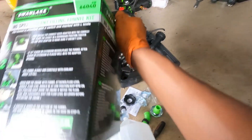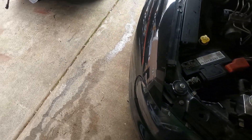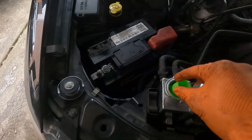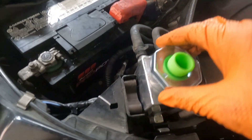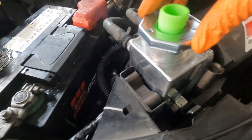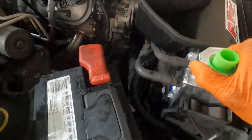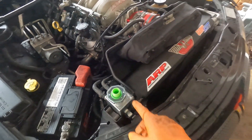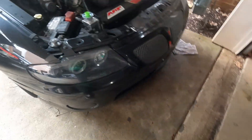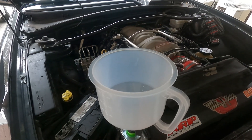For this kit you get a whole bunch of stuff — basically all you need is the adaptive fixture for the radiator. For the GTO it's this big one; I'm just going to use this straight piece. This end goes on here and then that will screw down, this goes in your cap and it will seal to the radiator. That goes in here, that seal goes down, that goes over it — make sure you line your things up, press down and screw that on.